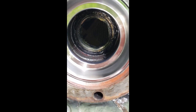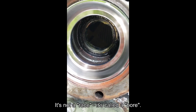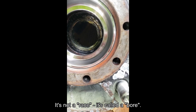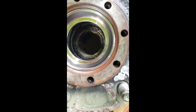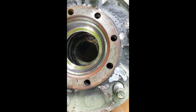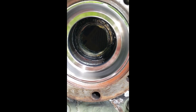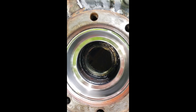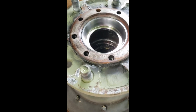There's the inner bearing, and you might be able to see that it is actually slotted on the inner bearing race — the inside race on the inner bearing. What happens is the inner bearing has a seal on the other side that butts up against that air sleeve I was just showing you. Air comes out of the air sleeve through these slots in the inner bearing race and into the hub, and from this hollow space in the hub, it goes out through this hole.